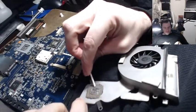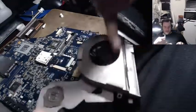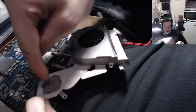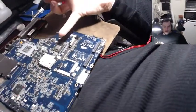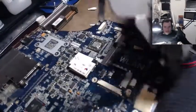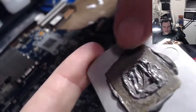I'm applying thermal compound which ensures proper heat transfer between this aluminum heat sink plate, which is connected to an aluminum chassis for a fan designed to draw heat down into the chassis and then into these cooling fins where the heat gets released into the air. I also put compound here on the microprocessor chip which is buried underneath this gray stuff. Compounds are on, and I've got this plastic spacer thing on too. You can see the plastic right here, and this little square board.